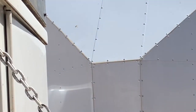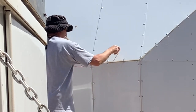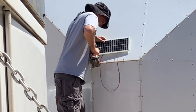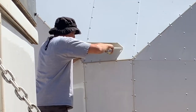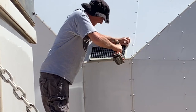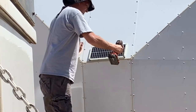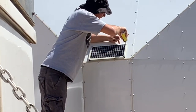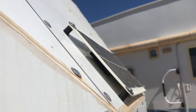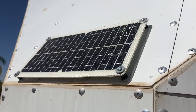This enclosed trailer is actually a garage for my Razor, and I purchased a 10-watt solar panel to charge that Razor. I was marking my spot to run my wires through the enclosed trailer. I cut the pigtail end off of the solar panel because I did not want to drill a big hole in my enclosed trailer, making sure to cut those wires individually to avoid shorting it out. Then I held the solar panel up in place and pre-drilled a couple small holes to anchor it. I used silicone on the wire going into the trailer and on all four mounting holes. I also had to use some half-inch spacers — leftover from a TV wall mount — to space the panel away from the trailer so the recessed wire area wouldn't rub.